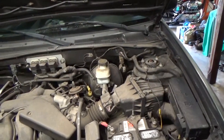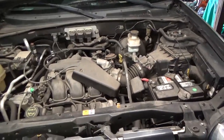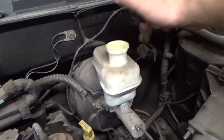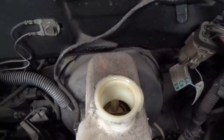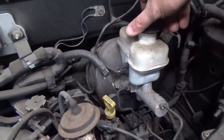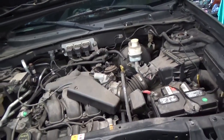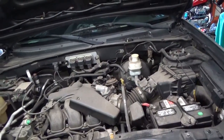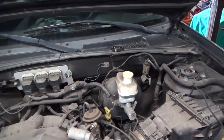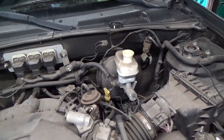The vehicle is in the shop. I did verify the complaint — the brake pedal is super low and it feels like we have a loss of fluid. It's low, but just not low enough for the warning light to come on yet because it's not down to the level sensor. We definitely know that brake fluid is going somewhere, so now we've got to determine where.